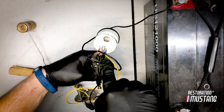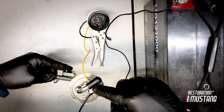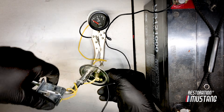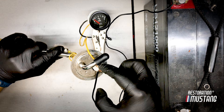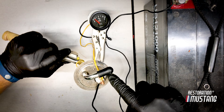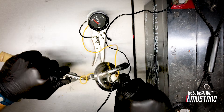This is the S wire — it stands for sending unit. This wire off of your gauge is going to connect here on your sending unit. The difference between these two wires: if you take your sending unit out and flip it upside down, see the yellow wire going to that terminal? That's the same terminal as the S. So that's your S terminal. The way you determine this is to pull your sending unit out of your tank, look at the sending unit itself, and look for the actual terminal — it's not going to tell you on the face side. The other side is simply a ground, going to any chassis ground near your gas tank.